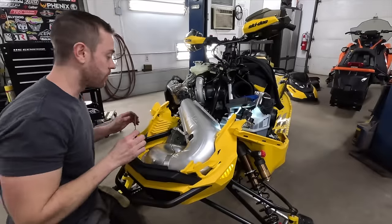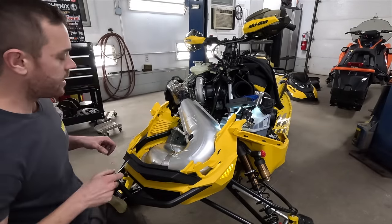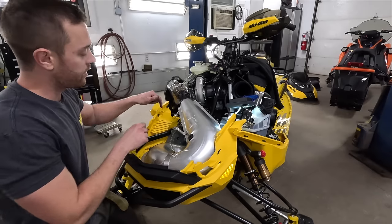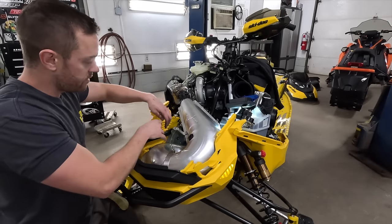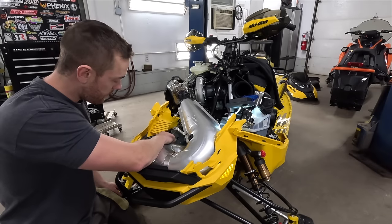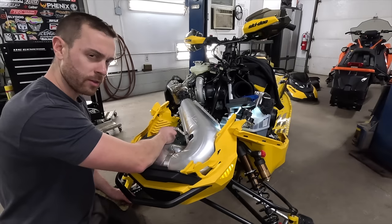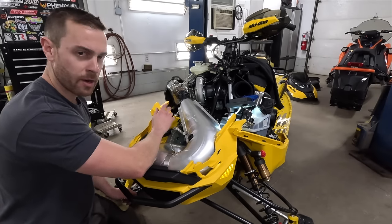I think I have this somewhat sorted out. I dropped the spring in here once already, and I said, I don't want to break the pipe pressure and temp sensor bundle right here, the whole bracketry and everything. It's 5/16. 8 mil should be roughly the same, but the 8 mil was very loose on the bolt, so the 5/16 fit better.